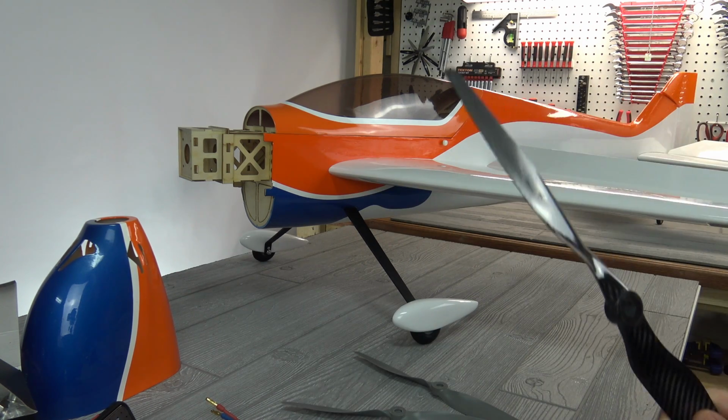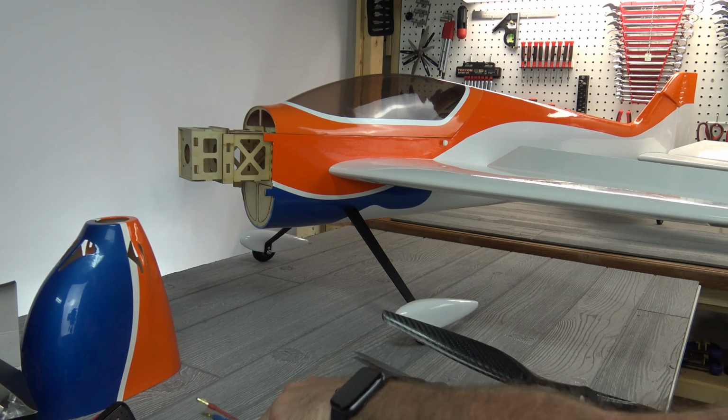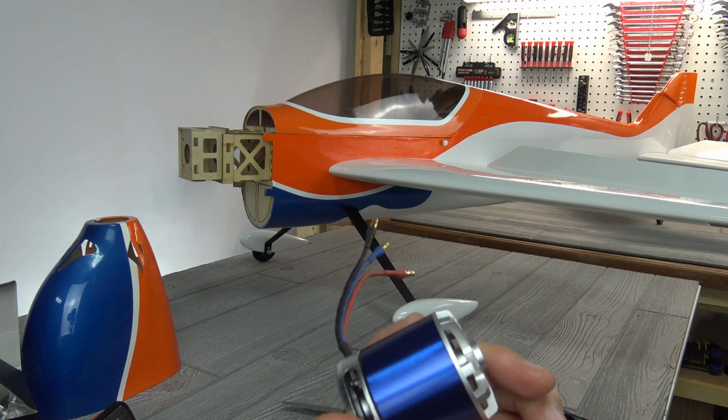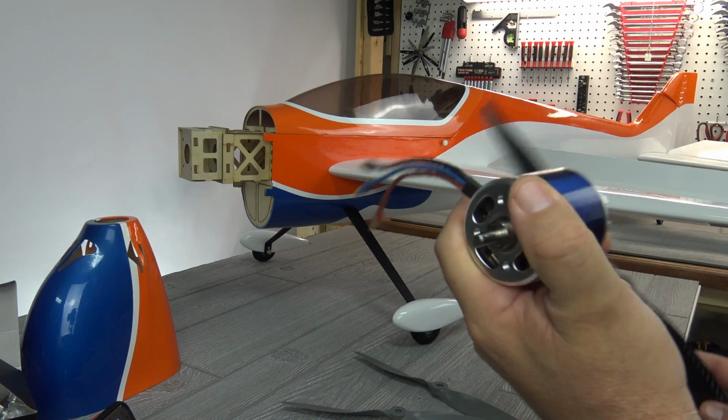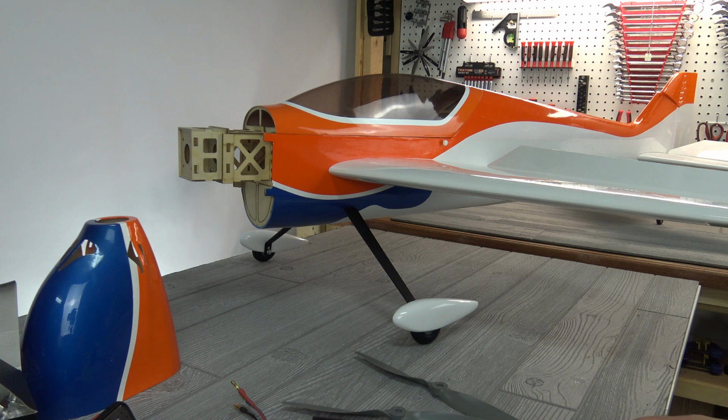Oh, one other thing. I was looking at the prop test data for the G601, and it looks like I'm going to be using a 5-cell, not a 6-cell on this plane. So I'll run the watt meter test just to make sure, but it does look like a 5-cell 4000 instead of a 6-cell 5000. Anyway, that's all I've got on the build review.